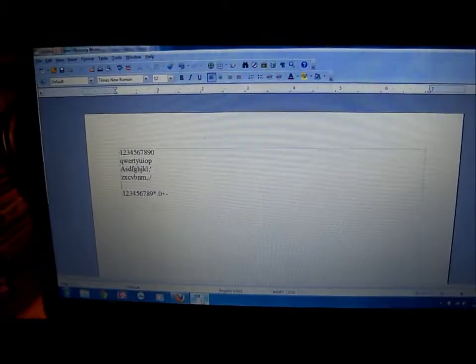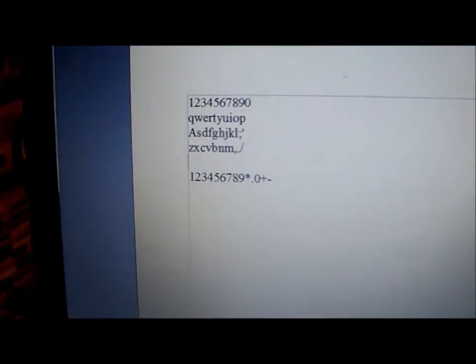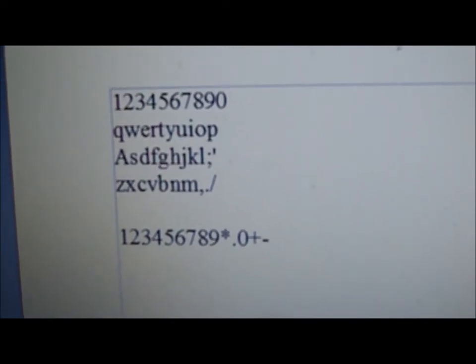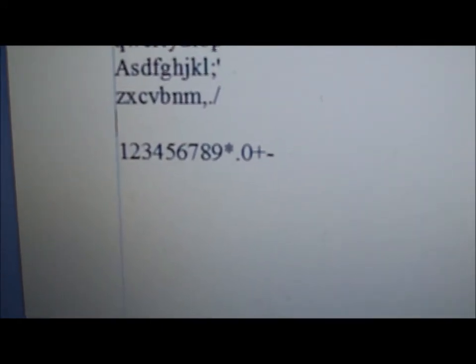Okay, so now I take the battery. I have these little spots to slide it forward into the housing. It clicks shut, and now we're going to try out the computer. As a check, I booted up the computer and went into an open office document, and I typed in each of the rows of the keyboard, and then down at the bottom the number keyboard. So it looks like everything is working. Mission accomplished.